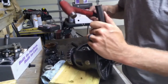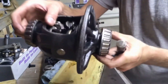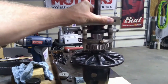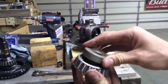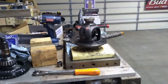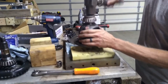Now while we've got this case apart, I like to grab a chisel to knock this bearing loose so I can put my puller behind it. If you do not have a puller like the one I'm going to show here, you can also just continue with a hammer and chisel to knock that off. I prefer to throw the puller in there and pull it off since I have it. When we install the bearings, we want to make sure that we leave that outer cage free so we do not damage it — if we damage the outer cage, our bearing risks failure. I have the special tools here, but if you have a nice selection of sockets you'll probably be fine. In the theme of using no special tools, I'm just going to drive that in with a hammer.